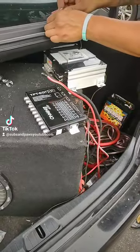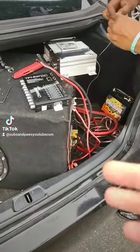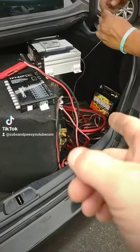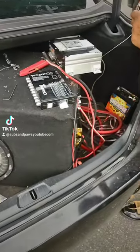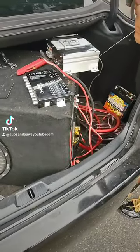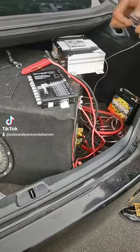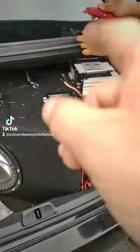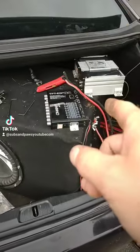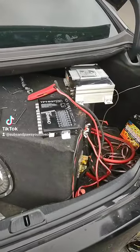You shouldn't even have to put a small amplifier onto a battery like that. The first thing I troubleshot was that battery — it was sitting at 9 volts, which means it wasn't getting power from somewhere, or it was just drained with no more life in it, or it wasn't charging. So he has the Soundstream Tarantula TXP 1.65.